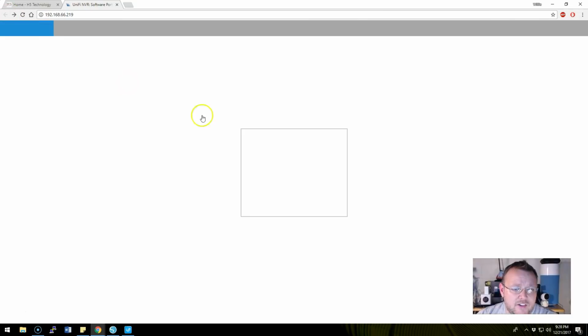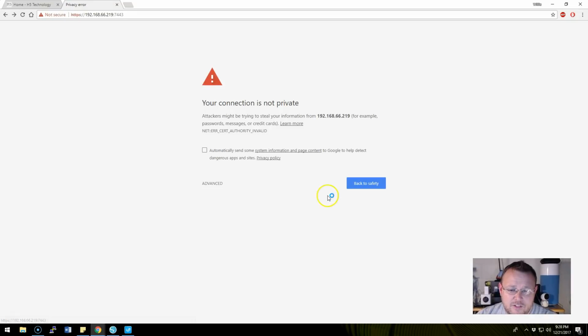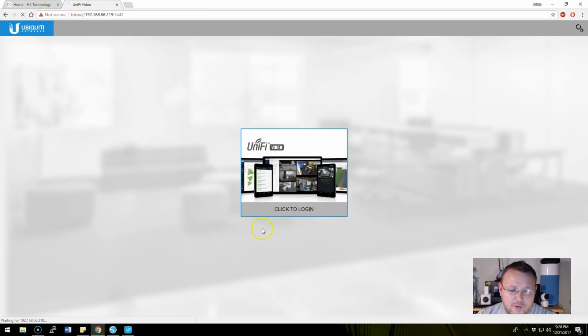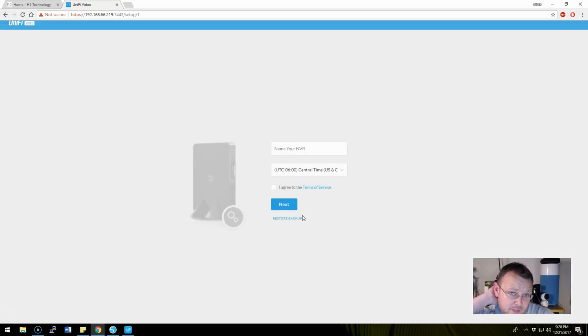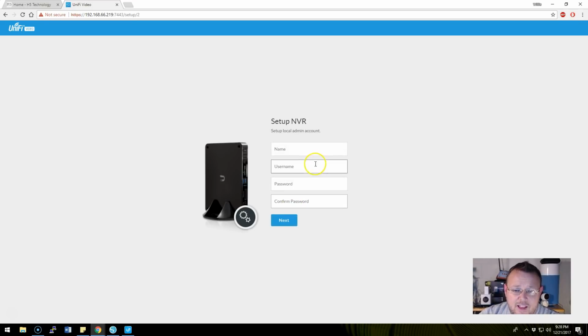So we will go back to our portal, and we will click the UniFi Video, and we'll click to log on. Of course, we don't have a CA cert, so we're going to get that. But now we should get the setup screen. So name your NVR, my NVR. It is Central Time. I agree. If we had a backup, we could click Restore Backup and import cameras and settings and the whole bit, but we don't have that. We're going to click Next.